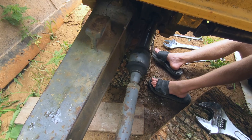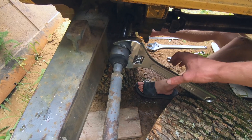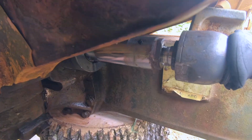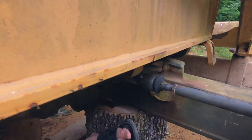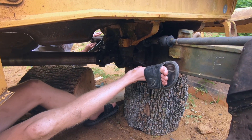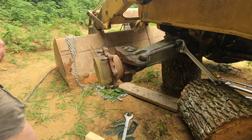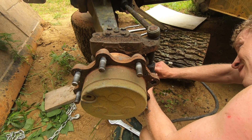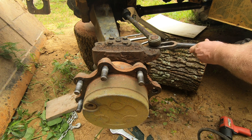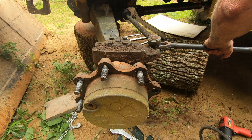This next step is a little bit tricky. There's a flat spot on each of the ball joints where you can put a wrench, and you need a pretty big source of leverage. We used two large adjustable wrenches and set one against the log, then used a foot in a pressing motion to break the other side free. You need to try breaking it free — go get the pickle fork. You remove the nut and then stick a pickle fork in the tie rod and hammer like your life depends on it.